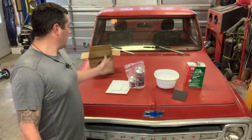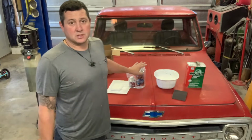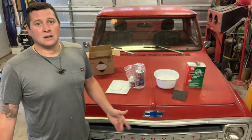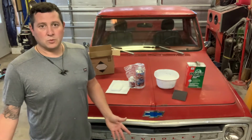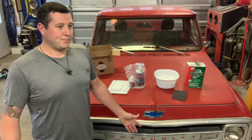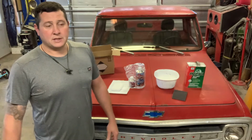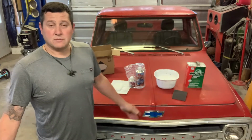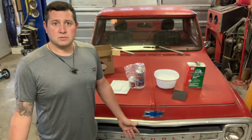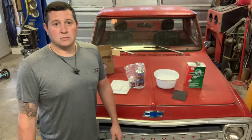Kind of cool, but what I started looking at is some clear options. I thought that just clear coating it would be neat. See a lot of people do it. There's a satin, you can go gloss, whatever you want. I found this company called Patina. Started looking into their products, and what kind of got me interested in them was the brush on or wipe on application. I'm not scared to spray anything, but I thought it'd be kind of nice, no overspray, don't have to tape everything off crazy. This stuff apparently wipes up real easy with some acetone, stuff like that. So if you do get it on trim or whatever, you can easily remove it. And it seems to self-level pretty nice, so I'm gonna give it a try. Worst case is I gotta do a little sanding if I don't like the way that it comes out, but I'm not scared of that.